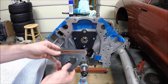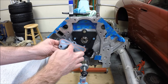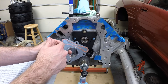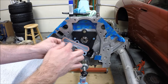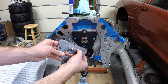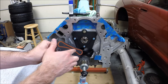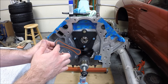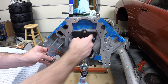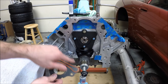This is the old camshaft retainer plate — you can see there's a seal, a gasket built into it. It's a good idea to replace this, particularly if it's a high mileage or older motor. Sometimes this seal can get compressed flat, and if it's dried out it won't seal well when you try to reuse it. So for a few bucks you can buy a new one and have a fresh gasket.